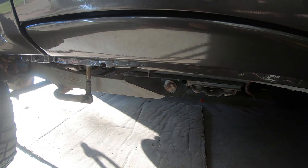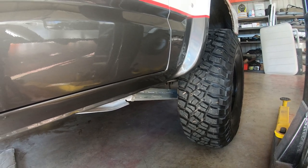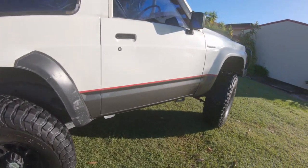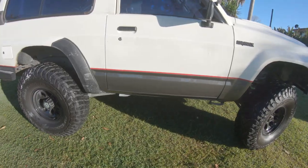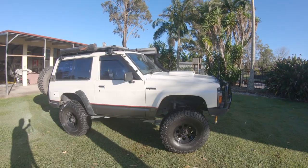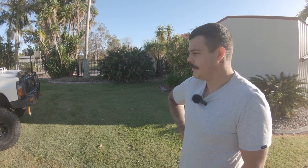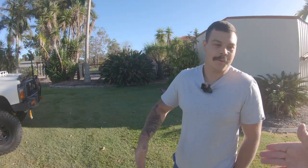There was a big groove in the door here, and you can't even see that now. The sill repairs — really happy with them. Nice and straight — can't tell we've done any patch panels there. There's a hole in the bottom of the sill to allow Hakeem to get some fish oil in there, and he's going to put some up around the B-pillar area as well — that should keep those patch panels from rusting for a very long time. The colour laid down beautifully — I can't see any mottling or tiger stripes. The panels are nice and straight. It's a bit of a mission, but we got there. Over three days, six patch panels plus the crease in the door. What's next for the old girl? It's got a pretty big trip next year — going to Tassie with the boys. This is a car for life. From Hakeem and I, keep the shiny side up. Bye now.